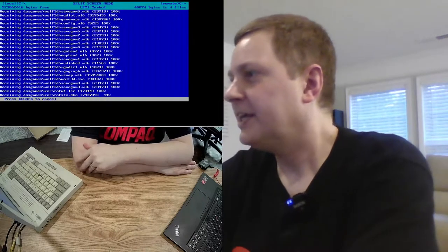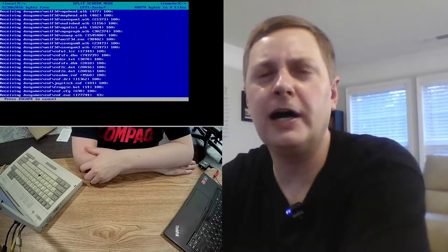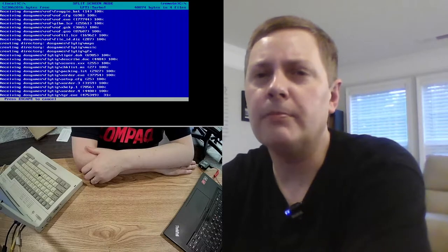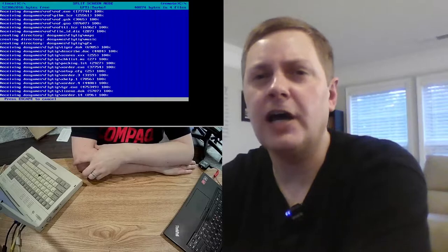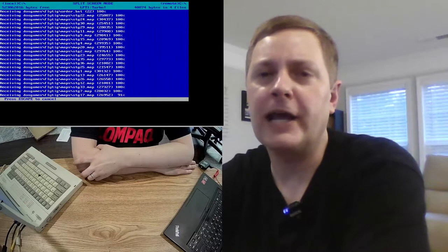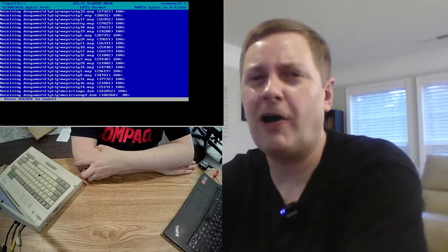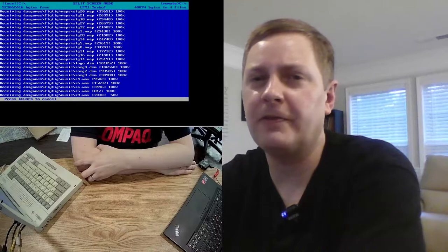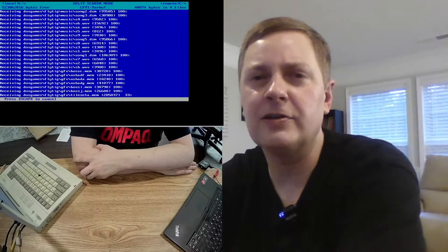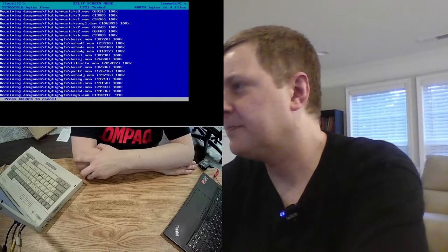Let's see. So, yeah, what else have I been working on? Working on a video. I think a lot of people do this, and they have different methods for it. But when you want to share data with DOS PCs, how do you do it? You know, that's a question. I use a Raspberry Pi. But in order to use a Raspberry Pi, you have to support SMB1. If you're to support a DOS machine, you have to use SMB1. So it's not hard to configure it, but I had to fiddle with it just a little bit until I found the right instructions online. So I thought, okay, I'll showcase that. So there's a video coming out on that as well that's currently in production, just waiting on an intro and an outro. It's actually ready to go otherwise. So that's kind of fun.